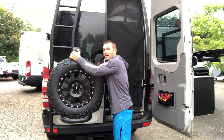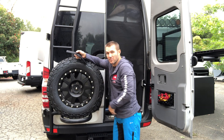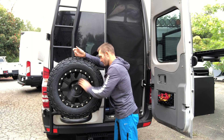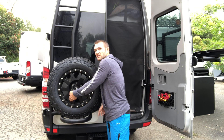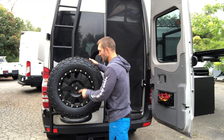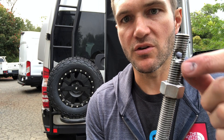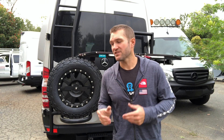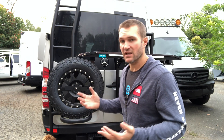Some wheels have a little plastic cap in the center — you can pop that out; you don't need to keep it because if you get a flat you can use a cap from the flat tire. With the spindle coming out of the center of the wheel, get the bottom of the tire all the way against the bottom, then rock the tire back so it's snug against the back of the ladder. The narrow part of the cone goes into the center hub of the wheel. Then spin your handle on — at a certain point you'll get tension. Make it tight but not so tight you can't get it off if you need the spare. There's no wobble in the tire. There's also a little hole in the front of the all-thread where you can put a padlock to secure your wheel. Overall the tire carrier should be fairly simple to install. If you have any problems, reach out to us — our phone number and email are on our website under the contact us page.